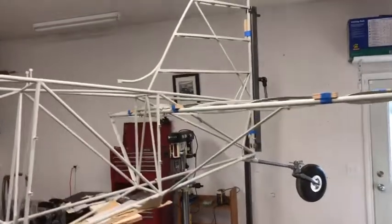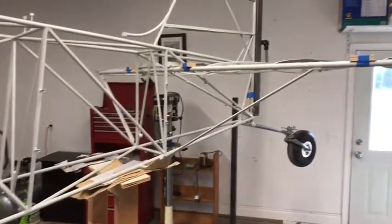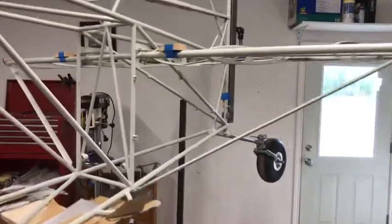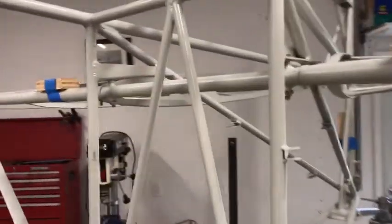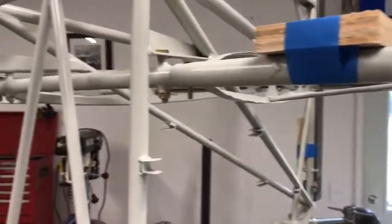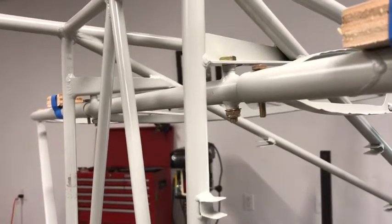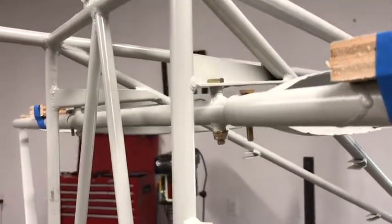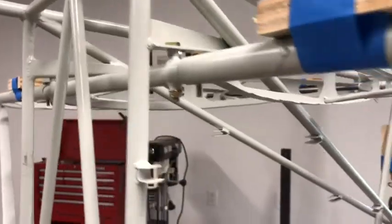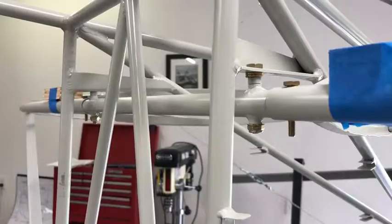Once you've got your trim torque tubes and your horizontal stabilizers, you can attach the through tube to the stabs, which then bolts to the brackets that are part of the fuselage. The bushing between the bracket and the through tube comes from the factory with the kit and is what establishes your three-degree down angle. You may have to adjust yours, as we'll cover later on.